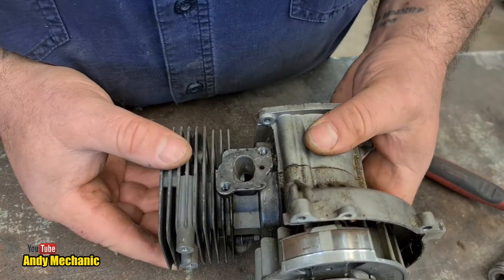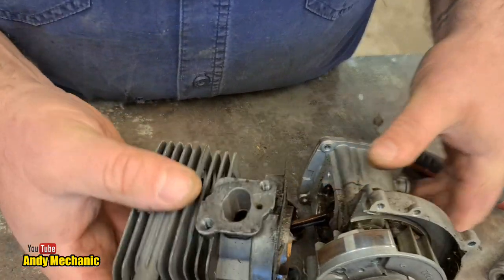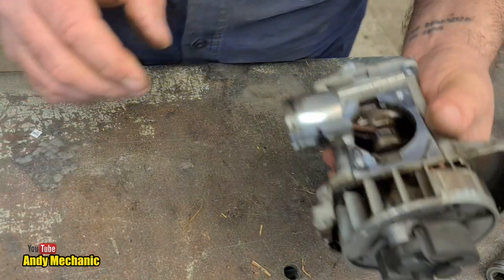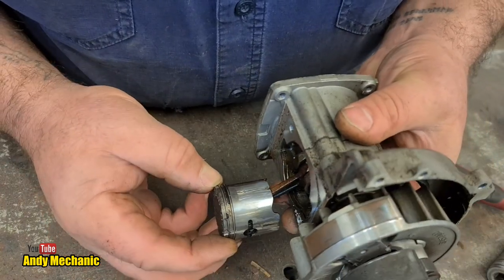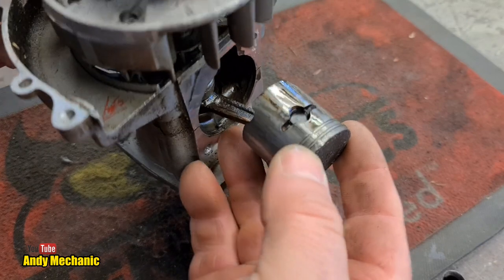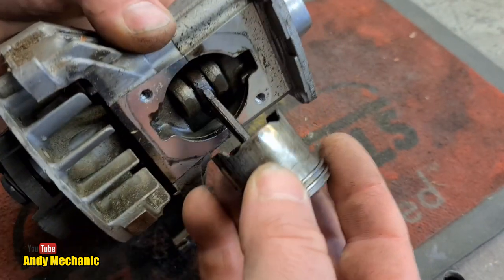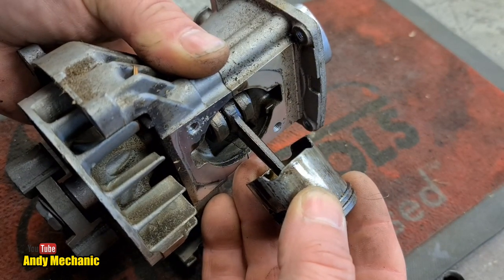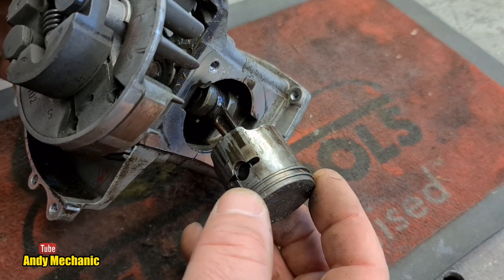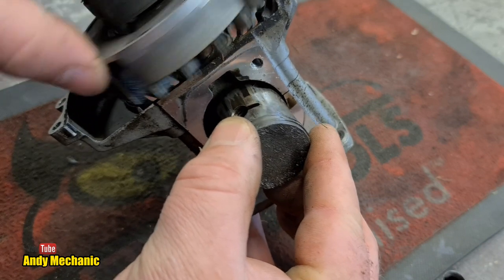Fantastic — now we should see the piston as we pull the cylinder off. There we go. Holy moly, this thing honestly weighs absolutely nothing. Okay, what does the piston look like? Well — it's been modified. Oh no, look at that. We've got some big chunks missing out of the piston itself — tiny little piston by the way. And it feels very loose on the big end, very very floppy. Look at that play on that big end — knock knock knock knock. So we've got big end failure, and the piston has obviously lost compression and was pretty much seized in the cylinder, which was causing it not to rotate. If we turn the crankshaft now — yes, it rotates full 360.